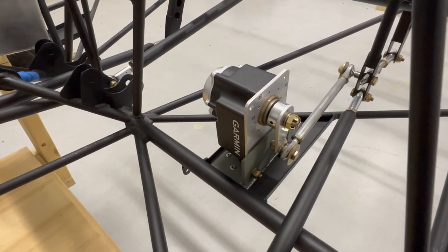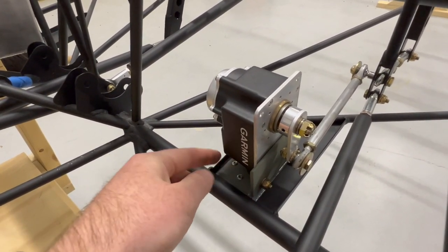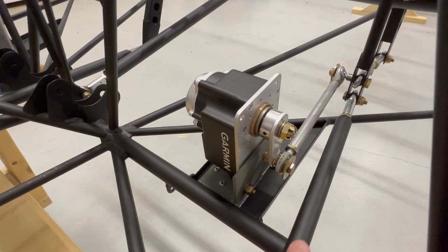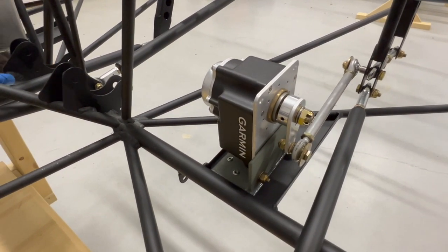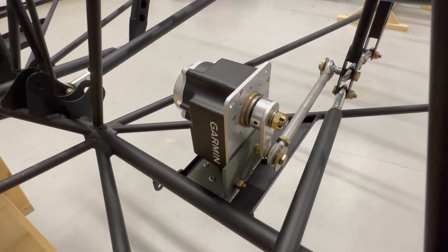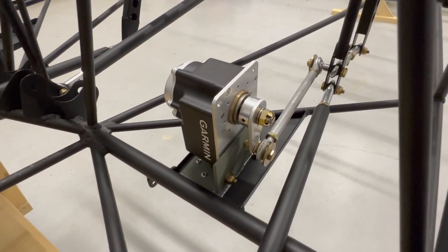Here at the roll servo position, this is a pretty easy install — this bracket just needed to be bonded and riveted in, and the servo attaches to it. I also connected up the rod arm for the servo that connects to the flapper on the push rod here. Nothing is rigged up in terms of final length, so I haven't attached the cage that protects the servo from over-rotating. I'm probably going to look at rigging the flight controls relatively soon just so I can get that cage on and verify travel.